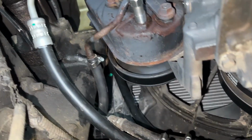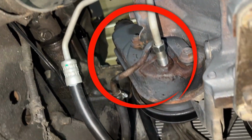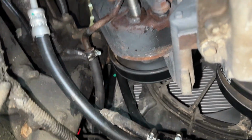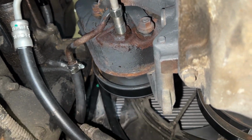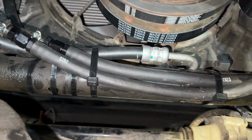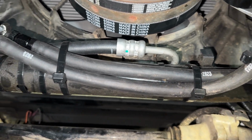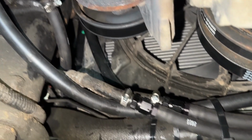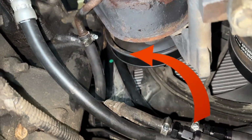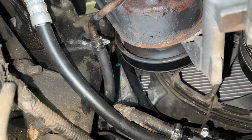Up here also, our high pressure truck power steering line. It comes off the back of the pump there, screws right into the stock pump, no adapters, that's a fitting on the line. Goes down, hits the chassis tube, we zip tie it there. The pipe has a crimped 180 on it, turn it around, shoot it up, which you can see it going up there. Goes to the top of the gearbox, bada boom, bada bing, done, right?